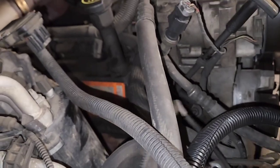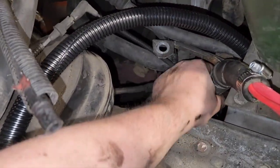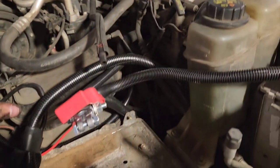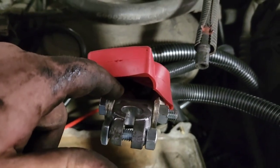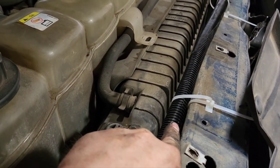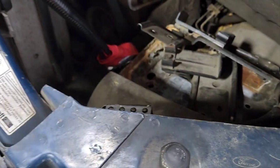Here's how I finagled the cable in — you kind of have to force it a little, especially with new copper because it has a memory from sitting in the box. Just fish it through and get it home, then tie it up. Coming back up top — it's all in the truck. Can't really record all of it, it's mostly just working through it. That's how I routed the starter solenoid wire down to the starter and then over to the other battery. I left the zip ties loose so the cable can sit in the right position.